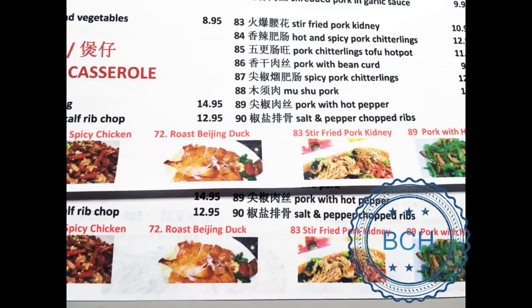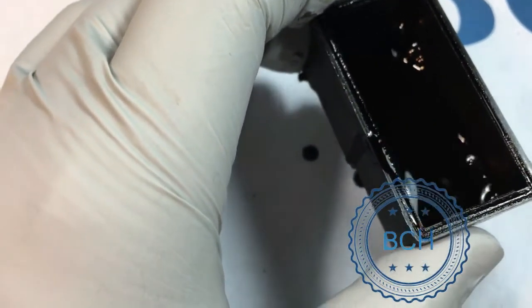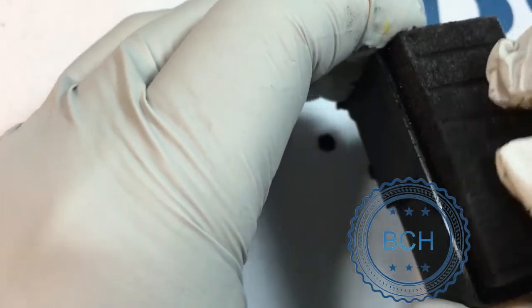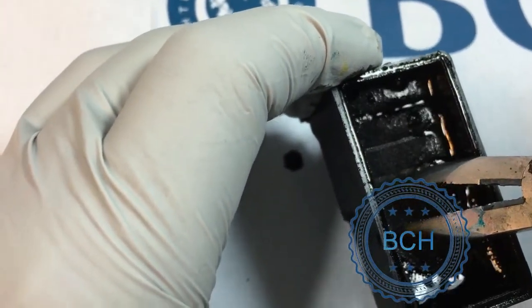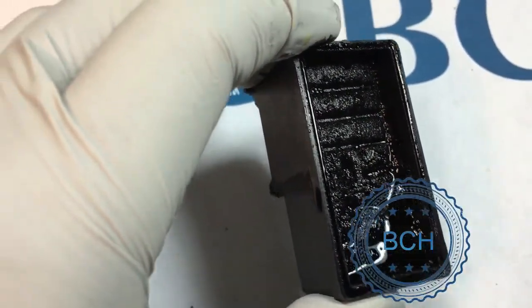This is the first page printed with Canon ink, and this is the last page of the test. We found the limiting factor is the sponge — it can only hold a limited amount of ink. At the end, we injected 8 milliliters of ink into the dry cartridge; it overflowed and could only take about 6 milliliters. Although the print head is as good as new, the sponge gets older. Smaller ink volume means more frequent refills.